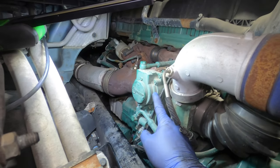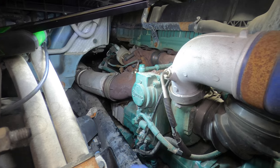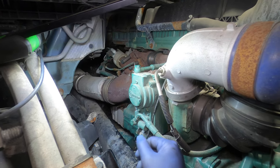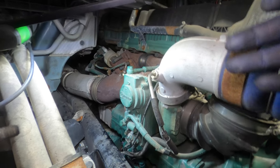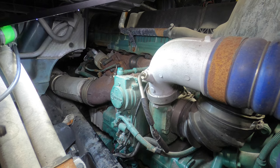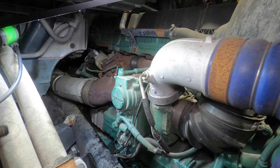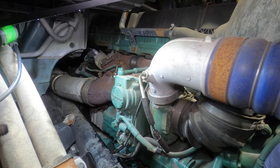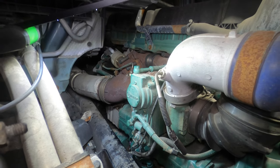Right here is what we got — the VGT right here, the turbo. What I'm going to be doing is removing the four bolts that hold the VGT onto the turbo. Hopefully separate it a little bit and free up the VGT. That's the reason why it's choking it up — that's a really common issue on these and the Cummins. So we're going to go ahead and loosen those up.